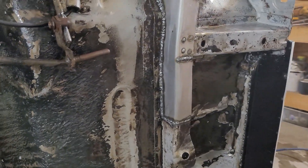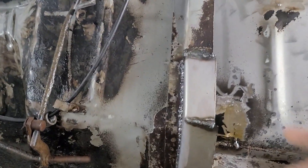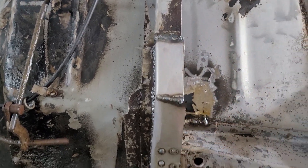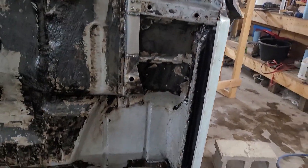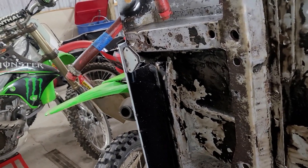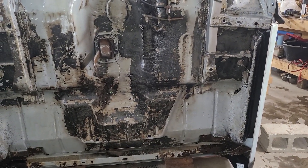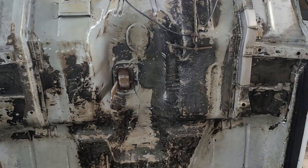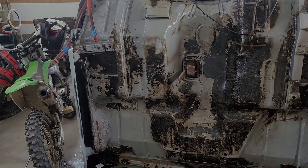I made my new structural piece here — it turned out pretty good, I was pretty happy with it. I'm going to hit the welds a little bit with the grinder, and also cut them down and even them up a little bit to make it look better. Everything else is pretty much done; I got one filler piece left right here to weld in. I did spray some converter on it — I'm going to see if that helps. Letting it dry up now, then I'll wipe it down, get my welding and grinding done, and should be getting this thing in undercoat. Getting pretty excited to get back on the truck.